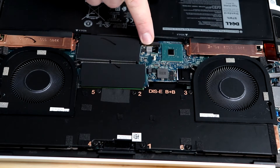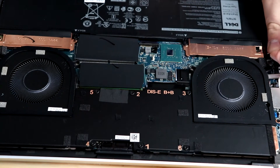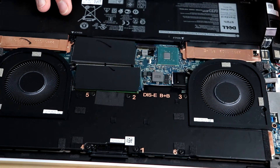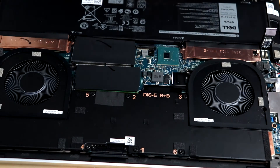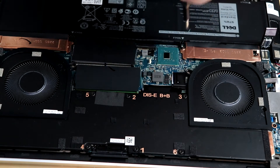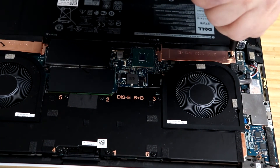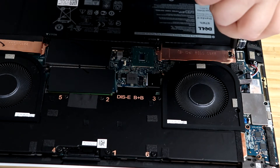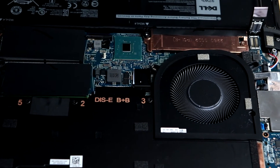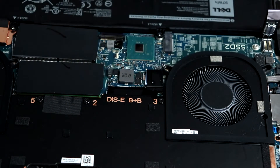Once you get the back off, we've got to disconnect the battery. There's a pull tab right here — just take it and pull up gently. You'll hear a little pop and it's done. Now grab your number two Phillips screwdriver. Go ahead and take out this screw here on the battery bracket, and then there's one right here on the other side. Take those two out — don't lose them. It will then lift out like so.